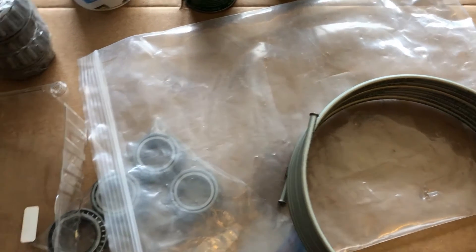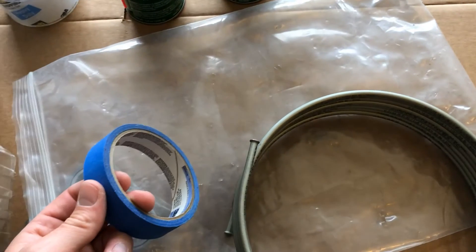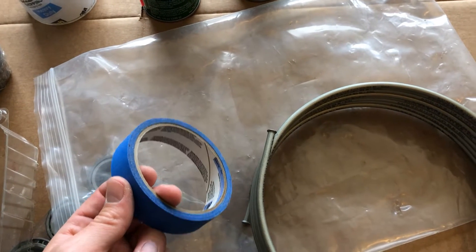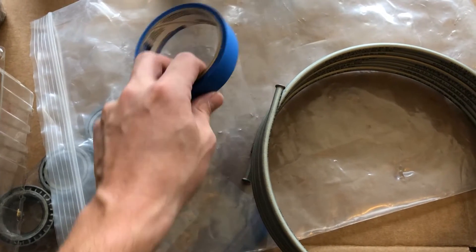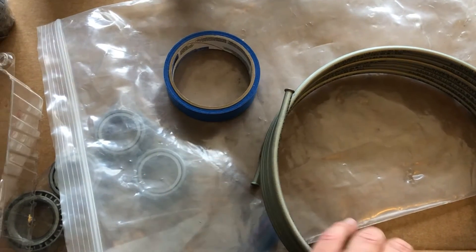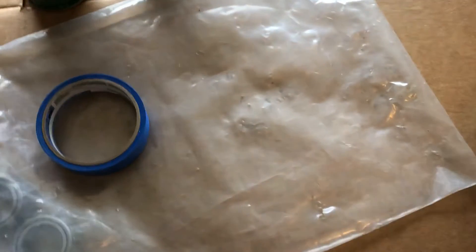Just to be extra safe, I've got my air compressor fired up and I'm going to blast some air through here to make sure there's nothing inside those lines. Then I'm going to lightly tape up the ends so that as I stretch this out and fit it into place, I'm not shoving dirt into either of those holes — you definitely don't want contamination inside your brake line.